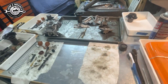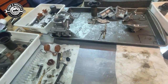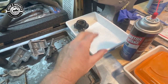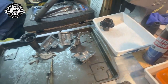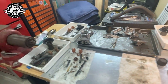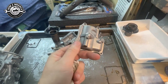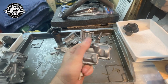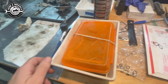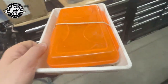Here's the goal: once I get the parts cleaned and ready to go back into the carburetor, they're going to make it to this clean white sheet, then into this bin that's ready to go. The carburetors are all labeled, the totes are labeled, so everything goes back in the exact same place. I've even taken a scratch awl and marked these bowls, because sometimes the drain might be on a different side — left or right — depending on the model.